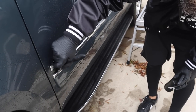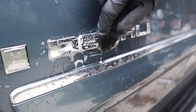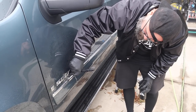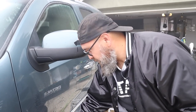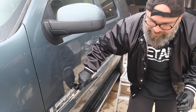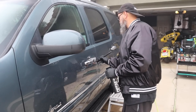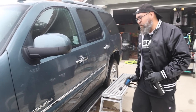So you spray it on the brush — yes, I'm spraying it on the brush and working it in. This is a boar's hair brush — professional detailing brushes that are nice and soft. I pre-soak them before doing this to soften them up so we're not scratching the surface. There's a little friction, but nothing crazy. The acid link will be down in the description so you guys can start working with it — just know that you buy the acid and dilute it so it's safe for paint. How'd you learn all this? Talking to guys, talking to suppliers. Shoutout to P&S East Bay — Steven.